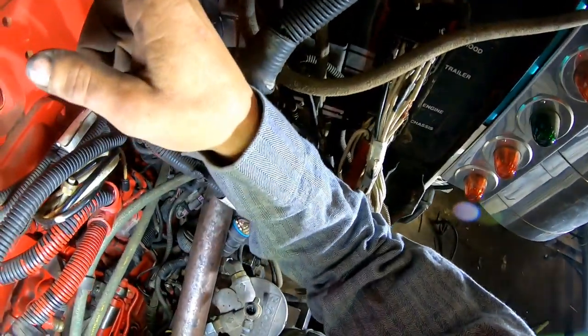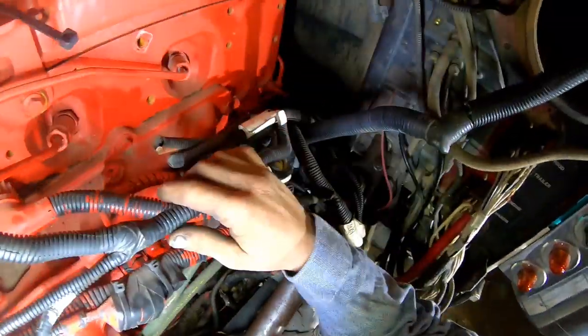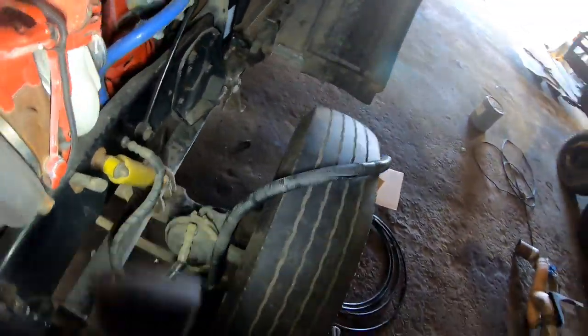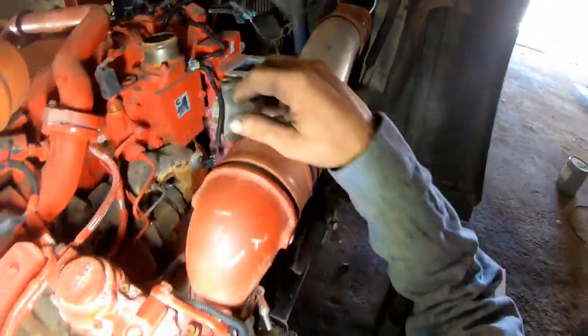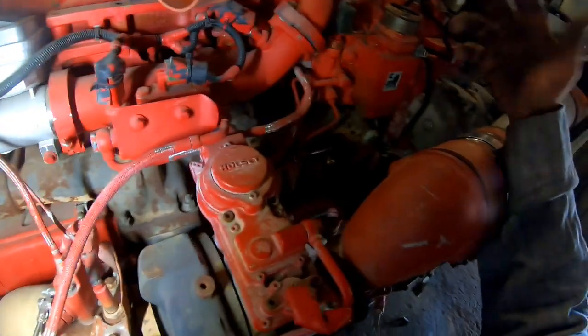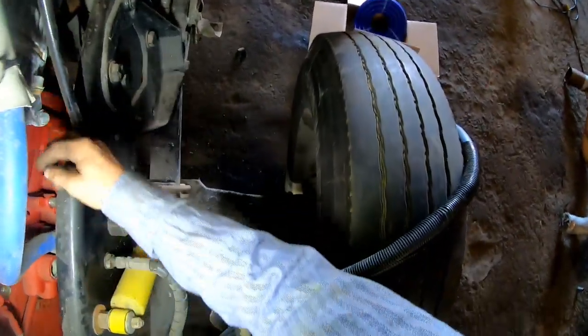The power comes up to the box where the mega fuse is then goes over to the alternator. I thought let's just use the circuit breaker that's already on here and come up from here with one cable. I don't see a ground stud on this alternator. The easy way is to use the ground on one of these bolts and ground it to the frame - there's a bolt on the frame right here. I don't see the sense in running another whole set of cables all the way over to the battery or starter post. It simplifies things to just run it to a ground source on the frame.